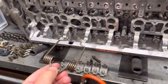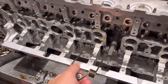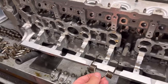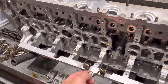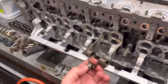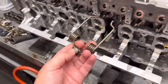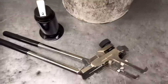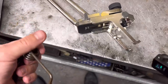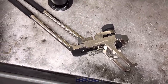On the four cylinders we don't have that much trouble — we can keep it all bolted up and bend the prongs back and behind the rockers. But on this six, there's just no room to do that and it's a slightly different setup. So I expect the tool holds it in position, bends the top down, and then you can torque the 6mm bolt up into the top of there, saving you from trying to rip the threads out, because you'd never bend that any other way. I'm going to have a little look into how to set this up — looks pretty interesting.